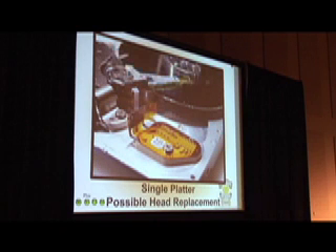This one is also possible. What you would use for your tools here is tweezers. Tweezers expand out, so you can bend them just right to hold them around this — but it's a little bit like Operation. You've got to make sure you do not touch your platter when putting them back on. These heads park in the middle and there's no outside ramp, so you've got to be extremely cautious while reassembling and trying to get it back on.